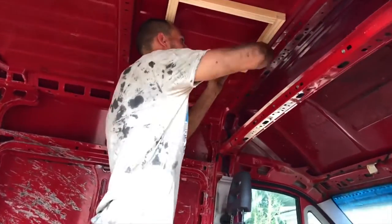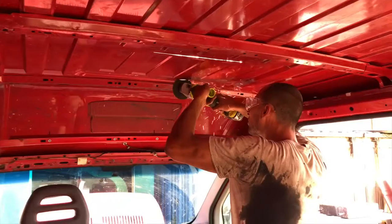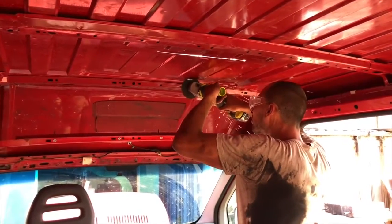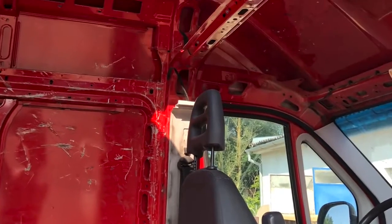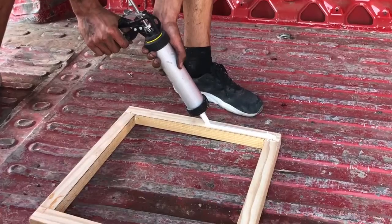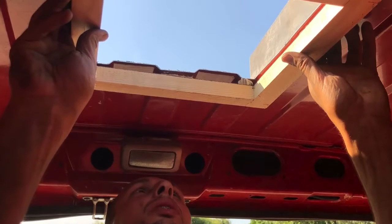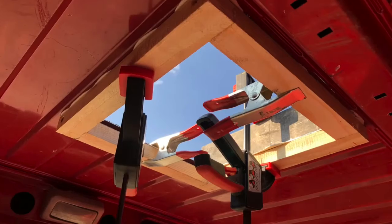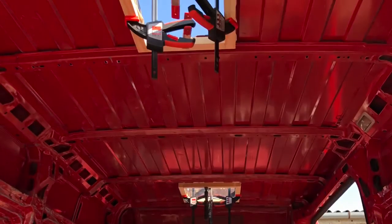Next are windows or roof windows. Do all the main things right at the beginning — decide where you want them and cut holes for them. Next I made a simple wooden frame to even up the thickness of the entire roof. The window clamps together like a sandwich and for proper fit it needs solid support. Just make sure the top part of a roof window or side windows is properly sealed. For that you need some good glue that is pretty resilient towards weather conditions.